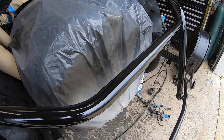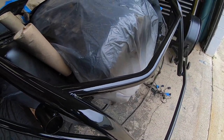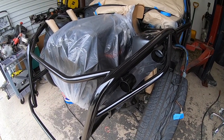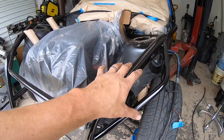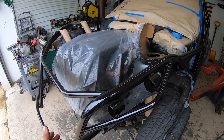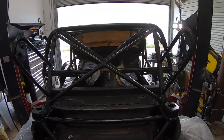SPI — Southern Polyurethanes Incorporated out of Georgia — is a really good product. It sprays really smooth, and if you thought POR-15 was strong, this stuff you have to grind off. I had about a quart left and it came out really good. For any chassis or bare metal work, this epoxy is fantastic — better than any primer in my opinion. I'm not sponsored, but hot rod guys use this stuff especially on frame and chassis work.